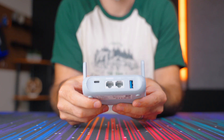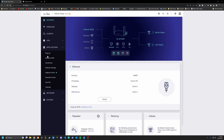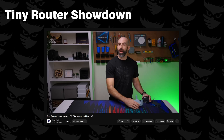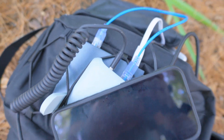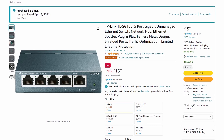For networking, we're going with what I think is one of the best travel routers in the game: the GL-iNET Beryl AX. It's a compact device running a custom build of OpenWrt, which gives us all kinds of fancy networking features like AdGuard, VPN server and clients, local DNS, multiple WANs, and even Wi-Fi 6. The main feature is the ability to plug in my phone and use the cellular 5G network as a WAN, so anywhere I have cell coverage, I have networking from my home lab. To give us a few more ports to connect client devices, I threw in a cheap 5-port gigabit dumb switch — probably about $15.